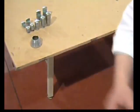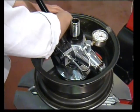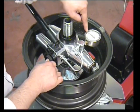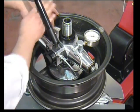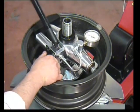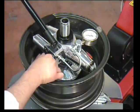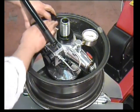We now begin working on the area of the rim which has been damaged. Before we apply the pressure there is a black spacer bar with 'up' engraved on it, which has to be placed to give contra pressure — otherwise we have a sort of egg shape on our rim. We watch the pressure gauge and will apply a smaller amount of pressure, probably around 100 bar to begin with. We are now applying pressure with the pressure handle.